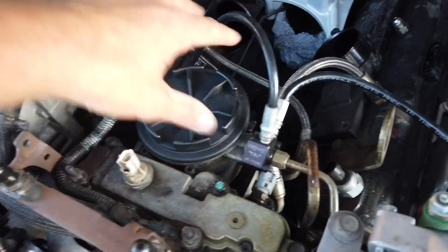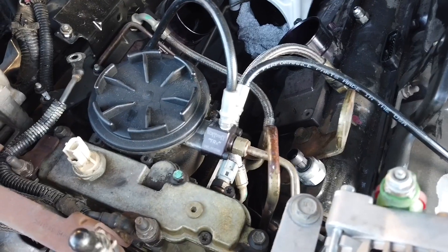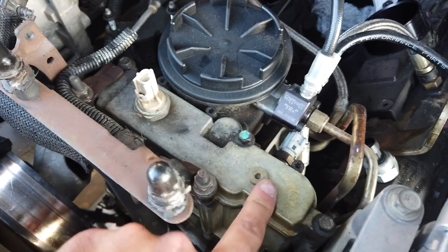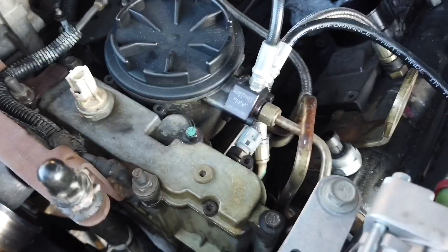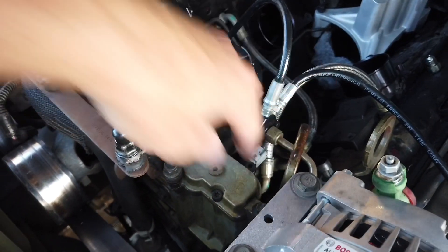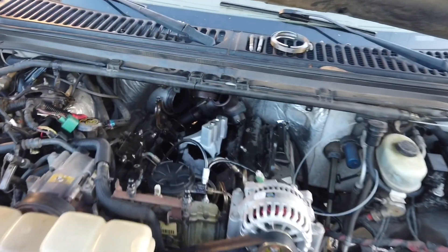There's also one on the back — that's the drain tube. So before you do that you want to drain the fuel bowl and then get it out. When doing the high pressure oil pump, I need to suck the oil out of the reservoir. I'm going to remove this cap and suck the oil out, because if I don't drain the reservoir first, all that oil is going to go into the valley.